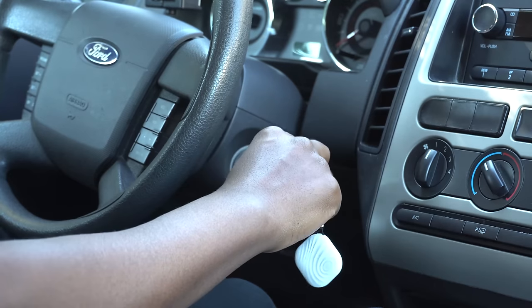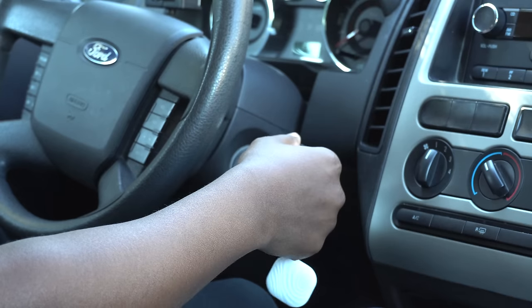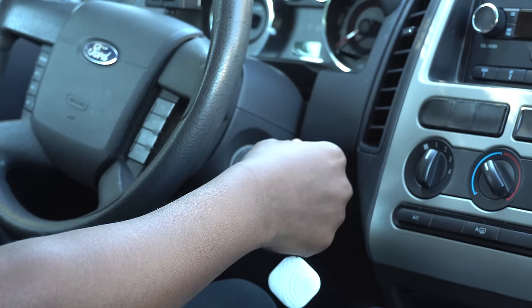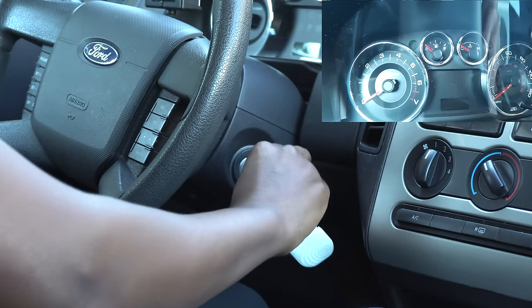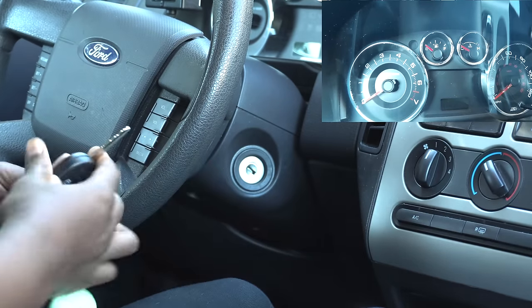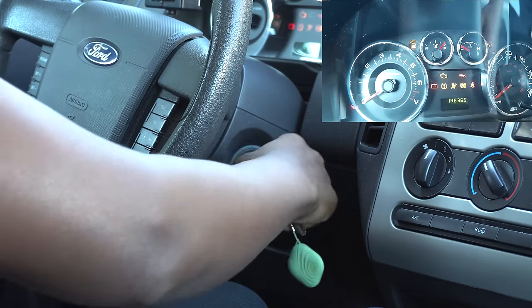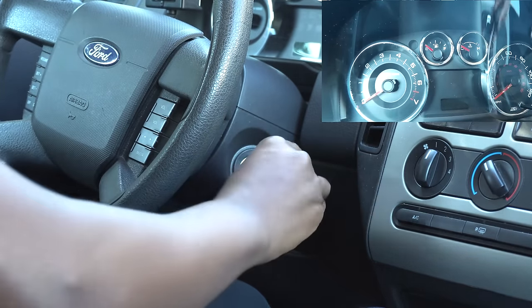You want to take the key, put it in the ignition — you're going to hear a chime. Then you have five seconds to put the other key in. Then you put the second key in, and then you have ten seconds to put the key in that you want to program. You hear the chime — you have five seconds to put the key in, then another chime, and you've got ten seconds to put in the key you want to program.